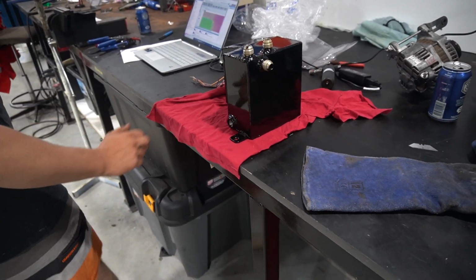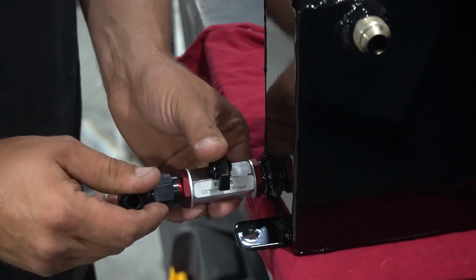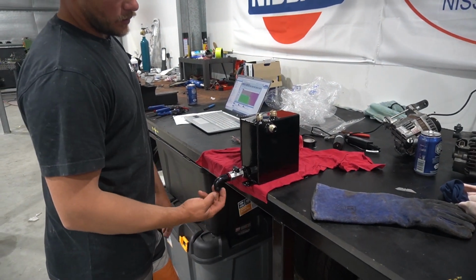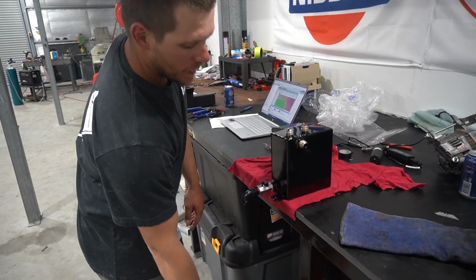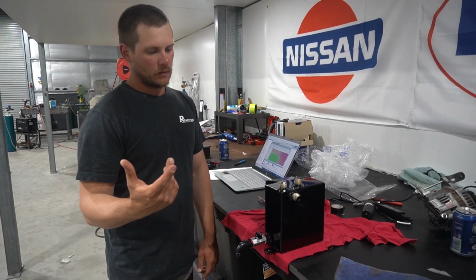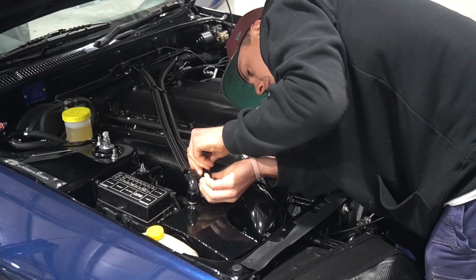And then there's a whole heap of shit to bolt on here and that too. What's going on there? That'll go like that. That'll end up like that. That'll end up like that. Which just clears the chassis rail. Chassis rail's literally here. And then another piece of Series 400-8 will go down like that, and it will hang like 20 mil below the chassis rail of the actual car. So then for the catch can you literally just stick a little cup underneath the Lewcid, open, twist that, bang, empties itself out, lock that off, we go.